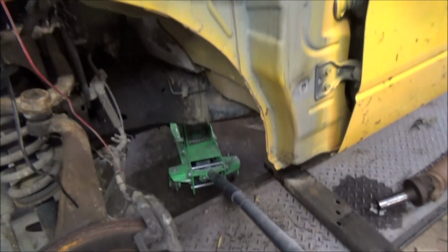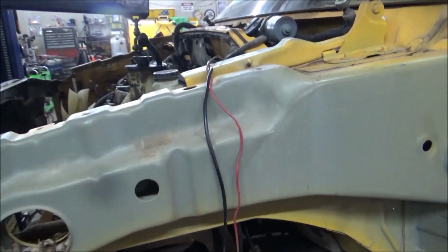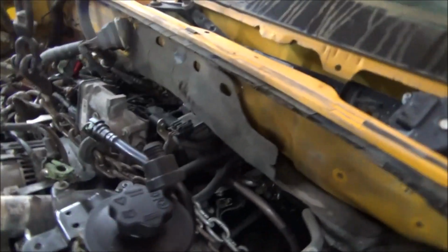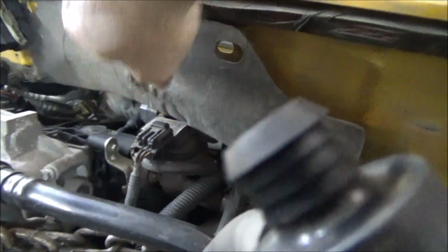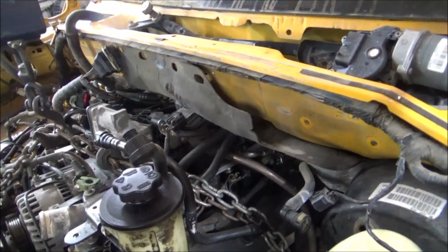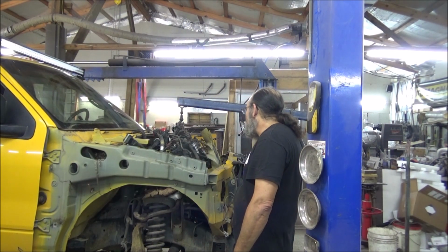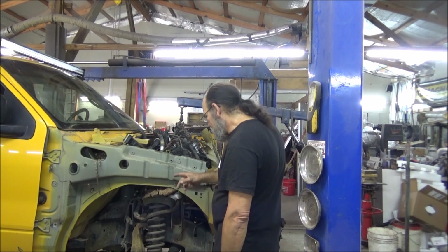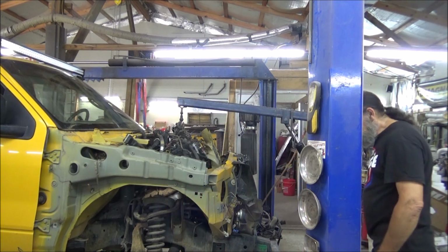Well, I got a jack under the transmission. That helped level it out some. But what the issue is here is that EGR is hidden. Yep, that is all over it. So let's get rid of that EGR. Taking the EGR loose and mashing it over did give us some room. There ain't a whole lot of room in here. Still got the jack under it. Let's just keep fiddling and see what we can do.